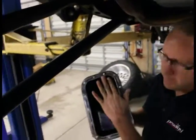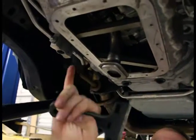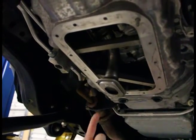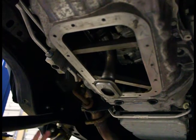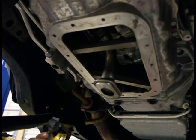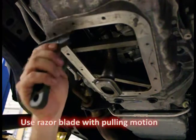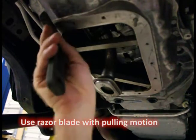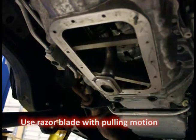On the wire wheel — six, seven minutes — just run right around it, make light work of it with the right tool. Now you're going to have the same type of residue on the oil pan surface, the upper pan surface. Simple fix: use just a regular scraping razor blade, use the pulling motion like this — just kept pulling at it, couple minutes of that, then wipe the surfaces. We're going to apply silicone here after we drill our hole in the next step.